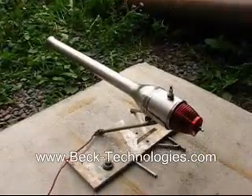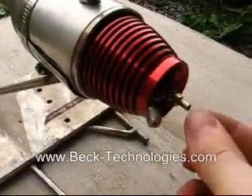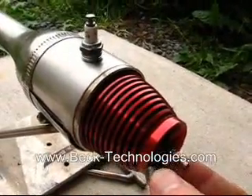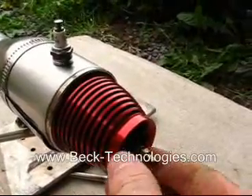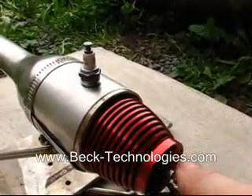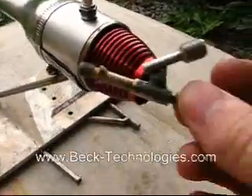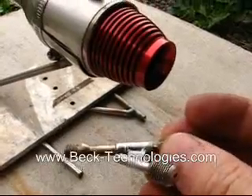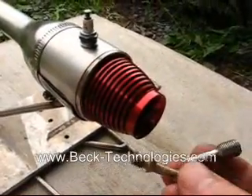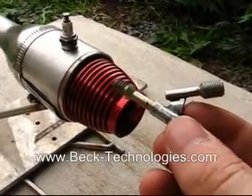The Dynajet has a few parts to it. Up front we have a metering jet, which controls how much fuel the engine gets. This goes into a fuel venturi, and this venturi unscrews from the valve head. The Dynajet has two fuel holes that the fuel gets sucked out of and turns into a fine spray. It also has a starting air tube — you blow compressed air into that and it flows out directly over the holes so you get the perfect amount of fuel for starting.